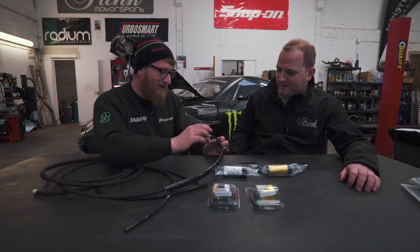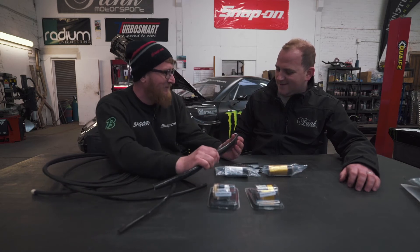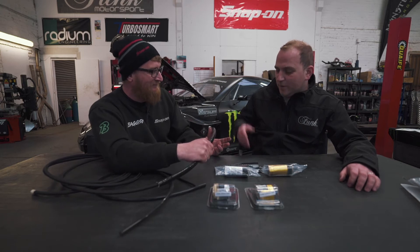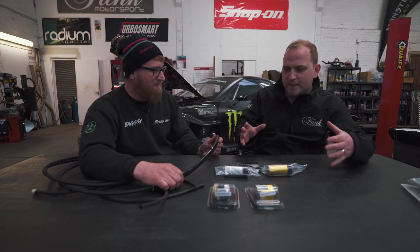We have put this on before and had it touching exhaust manifolds or parts of the turbo. With the black silicone it looks almost like it's supposed to be there. Sometimes when it is touching a turbo or a manifold it's not intended for that, but it can do it. Some people say it's starting to discolour — well, in actual fact, what that's doing is showing that the line itself, which would be touching it, is still protected inside. Essentially this is taking the brunt of that. You don't want to cause an oil leak, you don't want to cause a fire — you're just protecting that. And that's what all heat sleeving is about.